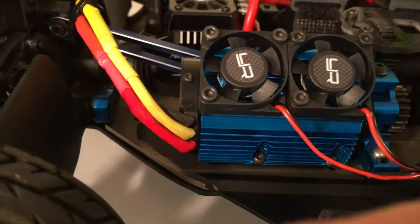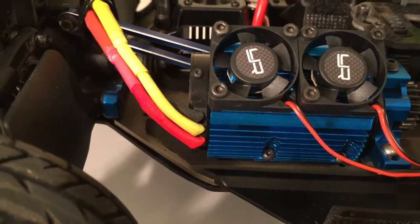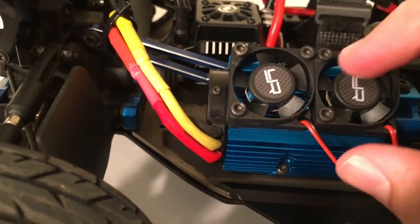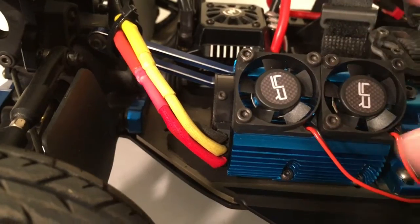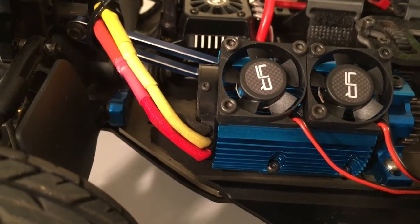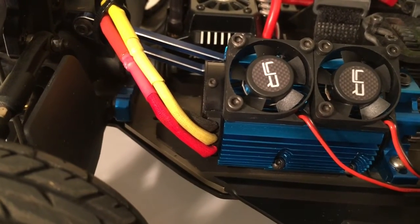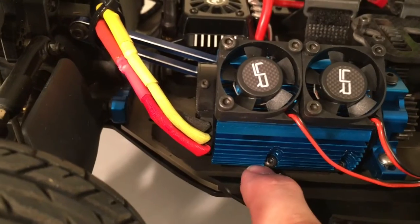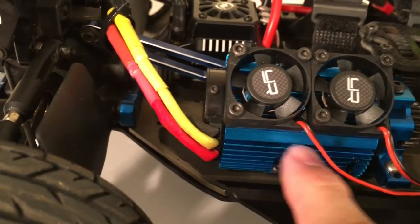on the bottom portion of the clamp, put a little bit of tape in there just to fill in some of the gap, because after I tightened it down you could still move the fan back and forth a little bit. I wanted it to be snug, so just that tidbit of information might help somebody out there. Pretty easy, just a couple of pieces of electrical tape on the bottom side of the clamp. The bottom side doesn't have fins and all that in it.